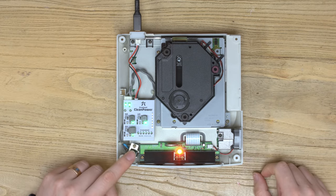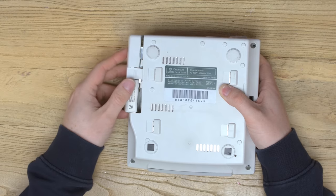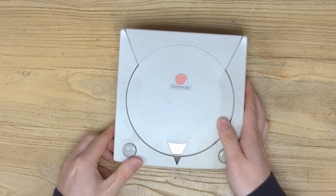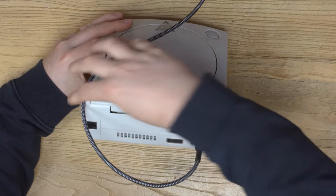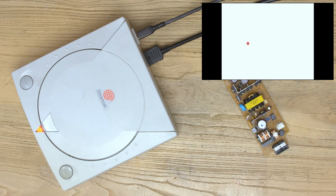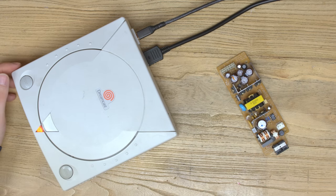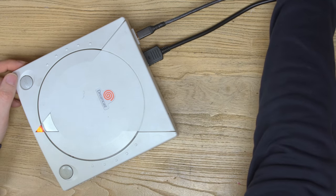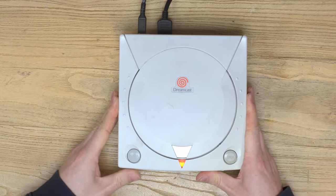You can see the power light on the Dreamcast as well, which is a good sign that it's on. Let's place the lid over and take a look if this is fully working. Let's re-plug in the modem, attach all the screws, and give this another go. You can see now a nice USB-C connector instead of an AC mains. I've got this connected up to the capture card, and when we turn on we should be able to see the boot logo — so everything's powering up and working fine. The disc spins and loads, so we're all good there. Pulling it up on the capture card, you can see how clean this video is — there's absolutely no interference at all. We can now get rid of this old power supply — sell it on eBay, sell it on our website, or give it to a friend. There's going to be plenty of these spare in the wild. And we can enjoy our brand new USB-C powered Dreamcast.